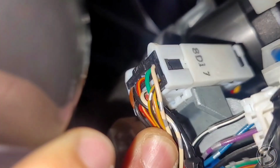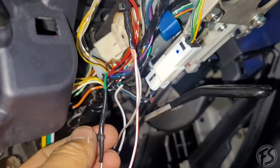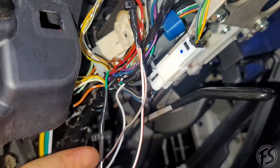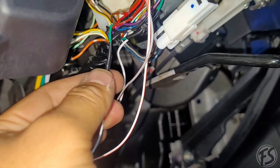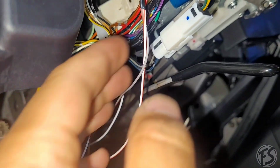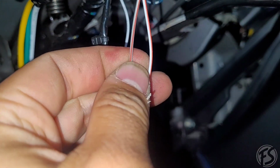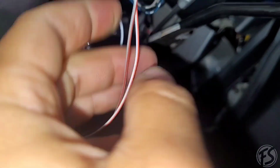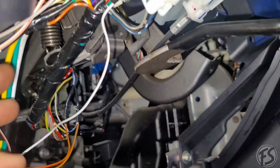which is that green right here. This one requires you to cut it in half, as that's the tumbler sensing. You're gonna need the white black from Compustar going to the cut away side of the plug, and then the gray red and white red going to the plug side, and they're wired together.